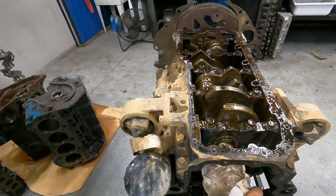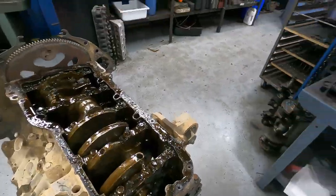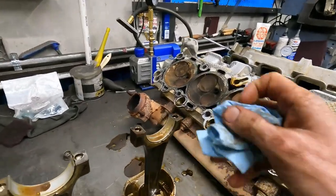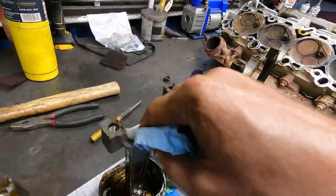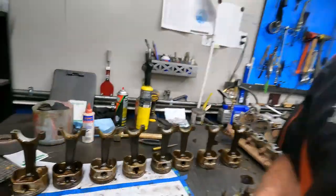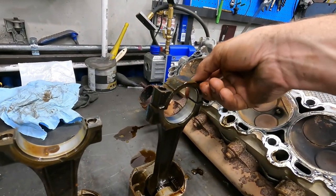Justin, let me just hone it and put these used pistons back in there. Even these — I didn't know this but the High Output version has a tri-metal instead of bi-metal rod bearing. I think they'd be reusable. Still got a lot of cleaning up to do. The rods are fracture-broken — casted and then broken so they only fit back with themselves. You can't mix up a single one of those caps.